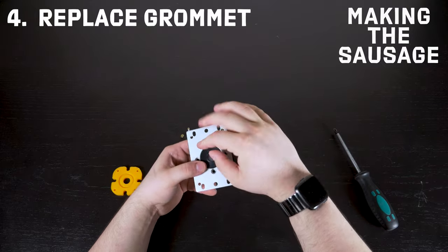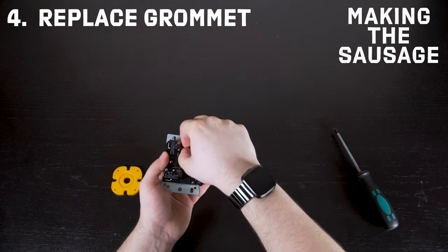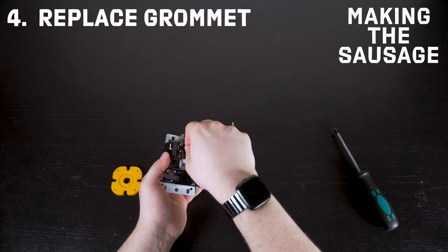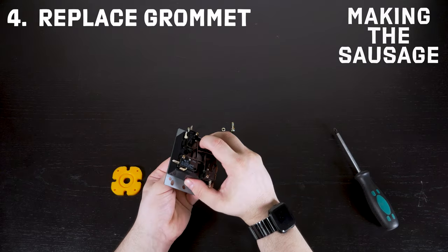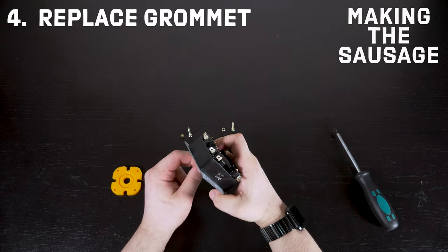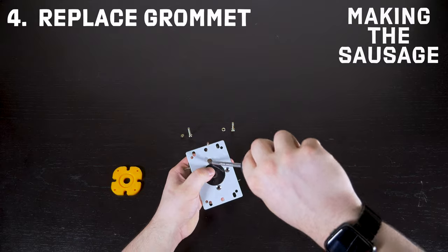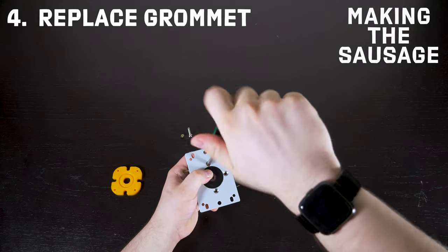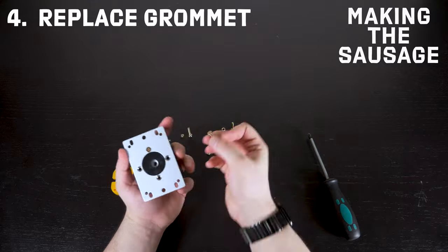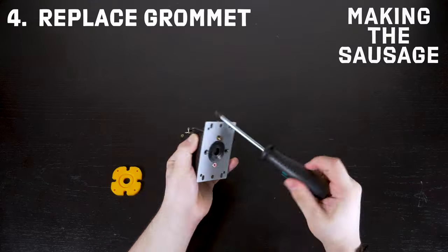Why 35A tension? That's from prior experience — my previous lever ran 35A after moving from the stock 25, and it was the best decision. Just like shoes, each brand has their own sizing but they're around the same ballpark; once you know your fit you can guess between brands. Now that all the screws are off, pop the metal lid. Hold the case upside down, put the little nut through the hole — it's shaped exactly like the nut so it drops in. Keep your finger underneath, drop the screw on top, it will line up and thread in. Just keep repeating that process, super easy, takes a couple minutes.